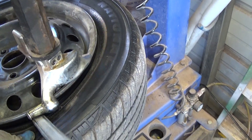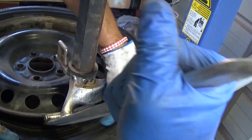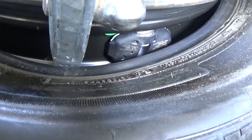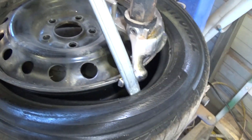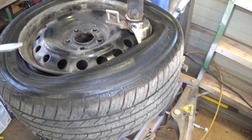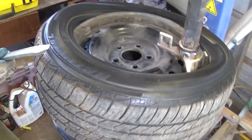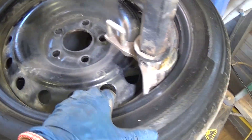Now we're just gonna get the bar, and you have to be careful not to get the valve stem — that's very important. So we're just gonna go in like that. You can see that's the valve stem with the sensor inside. You need to push in on the back side so you don't have any pressure, and it just goes like that — we don't turn it. It came out, and we're going to do the same procedure for the back side.